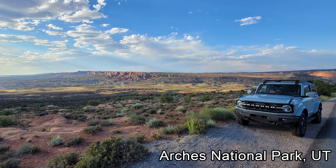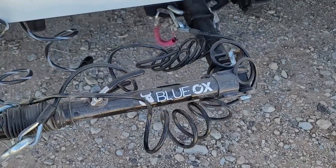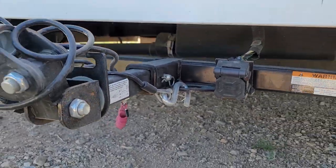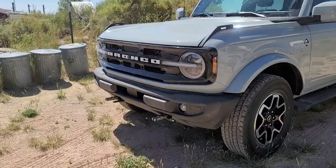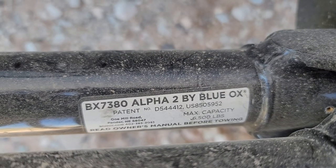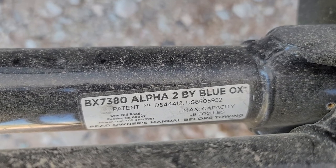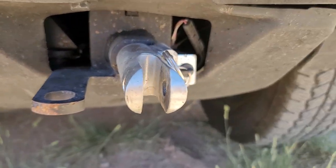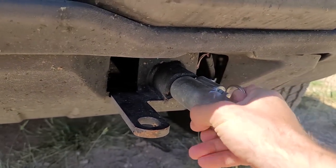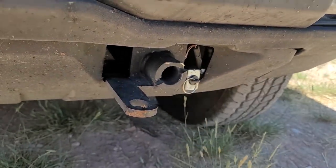Here's everything you'll need to buy, get, or install to make the Bronco flat-towable. First, very broadly, then I'll jump into specific parts. You'll need a tow bar — the actual device that connects your tow vehicle to the Bronco. It gets inserted into the hitch receiver on your tow vehicle and also gets connected to the Bronco. The tow bar has to be appropriately rated for the weight of your Bronco. You'll also need a base plate for the Bronco. Depending on your model, it'll get attached either to the modular bumper or in place of the tow hooks. This is what actually connects the Bronco to the tow bar.